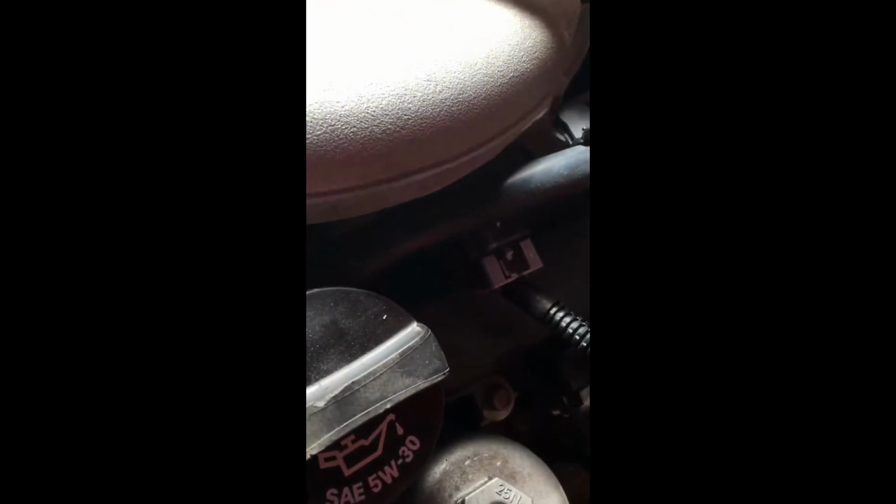Okay, I now have all the bolts off of the manifold. I just gotta manage to feng shui this thing out. I'm not too sure if I'm gonna have to go from the top or the bottom quite yet, but we'll see here. Just a little install tip here: the dipstick tube, I basically ended up just pulling on it and it pops out. I wasn't too sure if it did or not, but you'll probably have to line it up from the bottom when you put the Camaro header back on, but now this should pop out.